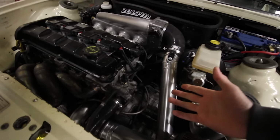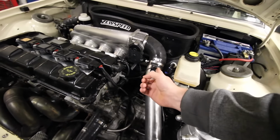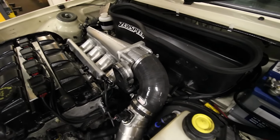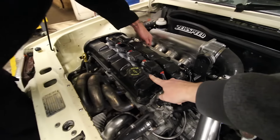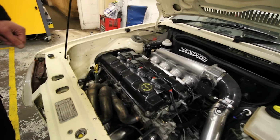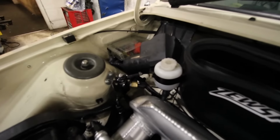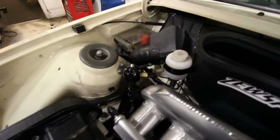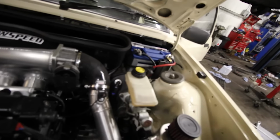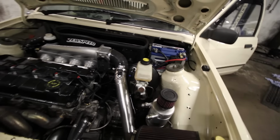It sort of works. So you've got water temperature, cam sensor, air temp. Your crazy fly-by-wire throttle body's all wired in. All your coils and injectors are in. You've made a neat little coil on plug bracket for your K20 coils since last time, I think. Fuel pressure regulator over there, with fuel pressure switch. Fuel pressure sensor, and that goes back to the ECU as well, doesn't it? And there's an oil pressure sensor, which is the same sensor as well. Pneumatic fittings in the servo and your little turn down bung, sealed and tapped, done. Yeah, that's really taking shape.